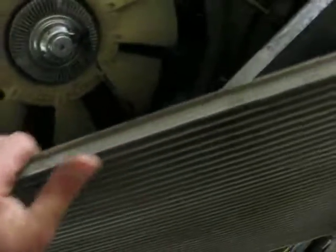Also, your AC cooler here — go ahead and just let it hang off to the side, kind of out of the way. It will flex enough to stay out of your way while you're doing this whole thing. These hoses give pretty good flex, so I'll leave it here — that way you don't discharge your AC system and have to pay extra money to get it recharged, vacuumed out and all that. We don't like to spend extra money.